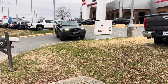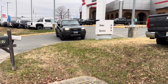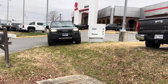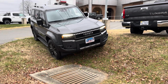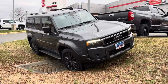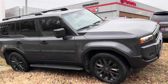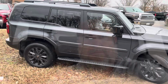Okay, this time I'm going to hit the stabilizer bar disconnect button, and I heard this little motor, and I have an indicator light on my dash now. I'm going to try the same path and see if you can see any difference as I'm going through this. And I'm going through it very slowly to try and illustrate how much, boy, I can actually feel it because I'm not getting as much body roll. It's not tipping as much, and it's keeping better contact with the road as I'm driving.